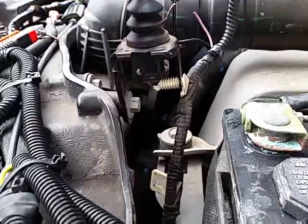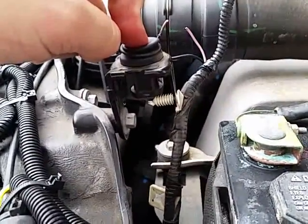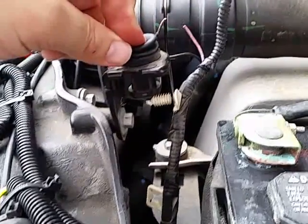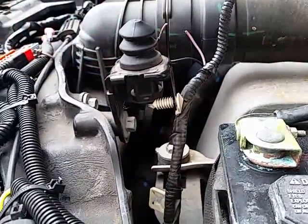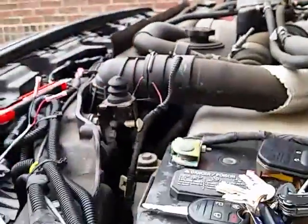The way of testing this to prove it accurate is if you hold this down, arm your alarm, wait 25 seconds for it to arm, and then cut that wire — your alarm's going to go off. So what we've done is we've wired the shock sensor to do that as well. I'll show you how I wired it.